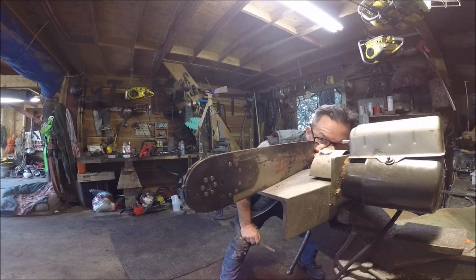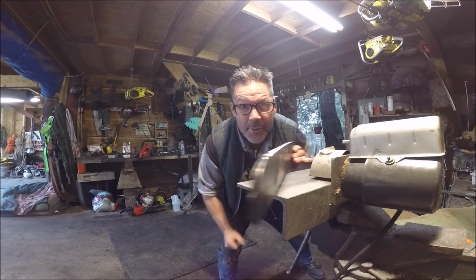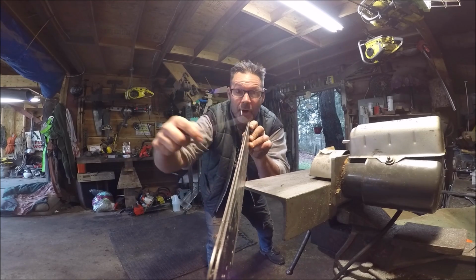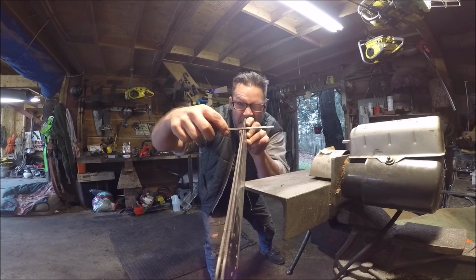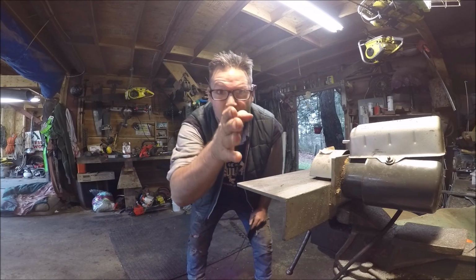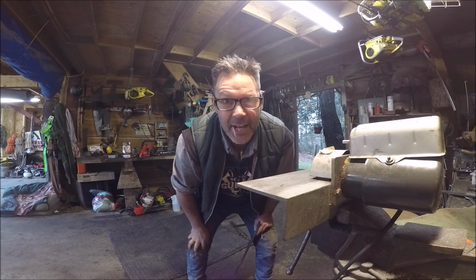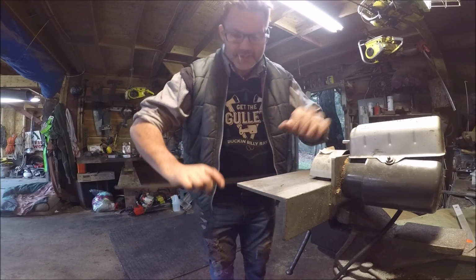Oh, you can literally see it. It's higher than that. Friends, get down and look like this. Put a flat edge on there. Friends, it's grinding your right side of the bar. It's not even touching. It's touching a little bit here now, but nothing down here. You can see it's higher. You cannot tell me that strap is going to sit on that rail. Then guess what's happening? You guessed it. You're cutting on an angle. That simple. Done. Keep your bar rail straight, friends.